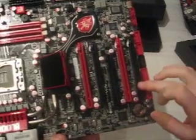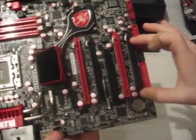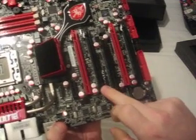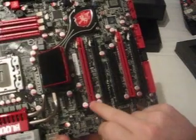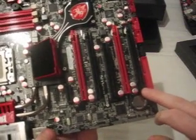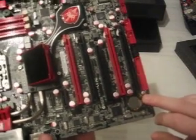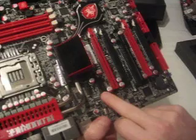Moving on, we've got the PCI Express slots — four of them: two PCI Express 2.0 x16 slots and two PCI Express 2.0 x8 slots (red and black respectively). This allows for SLI with two or three cards, or quad SLI with dual-GPU cards like the 9800 GX2 or the GTX 295. There are four slots for Crossfire or CrossFireX configurations — maybe four 4850s, or standard Crossfire with two 4870 X2s. There's also a single PCI slot (perhaps for a sound card) and a single PCI Express x1 slot (perhaps for a wireless card).